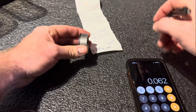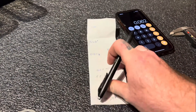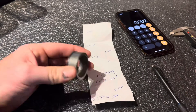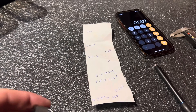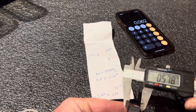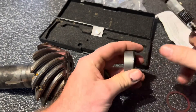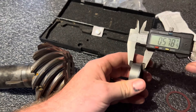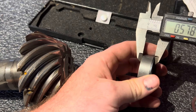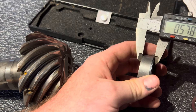It's either going to come out 0.577 or 0.578 — either one is acceptable. It's not a huge number since your shim pack isn't going to be perfect. We got 0.578, so that is perfectly fine — just a little bit higher than the old crush sleeve by just a hair, and that's okay. You're not going to get it perfect.